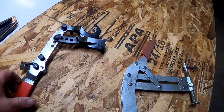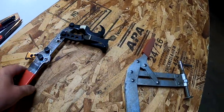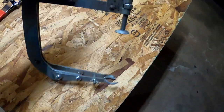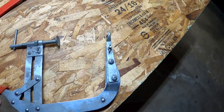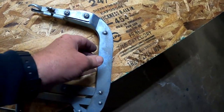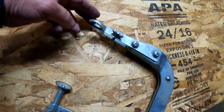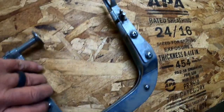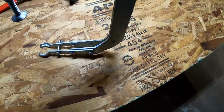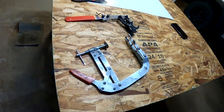So here's two types of spring compressors. This is the one I'm gonna use on the overhead cam engine, which is real handy to have, and I'll put the link in the description. This is one for if you were doing a head that's off the car, like on a small block Chevy, or I use this on a Cummins diesel. What you do is adjust the screw on the bottom of the head. This little cup goes on the top of the spring, and then you have a lever arm that you spin to make it compress, like so. But either of those tools work really well.